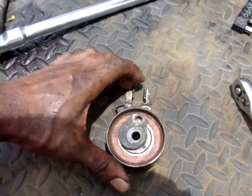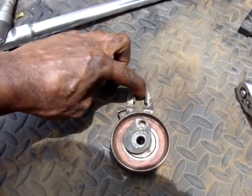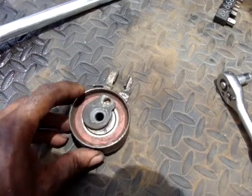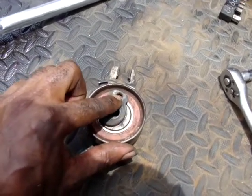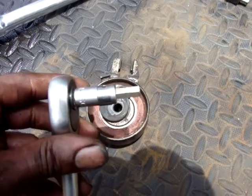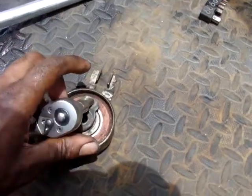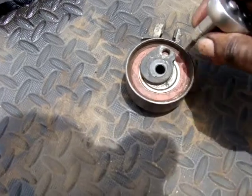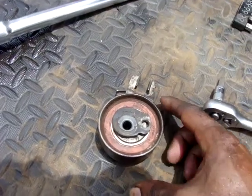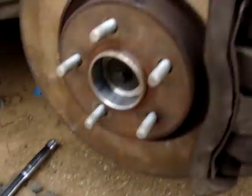So as you can see here, this empty space here should be between one notch, which is installed on the engine. This here is for the tension itself. So when you install it, this is the hole for the screw, and this one, after installing the timing belt, will be needing a, how you call this, a Torx. You place it in here and you turn it. This turning is actually the tensioning of the belt. The same procedure here, what we have done, should be done on the engine itself.